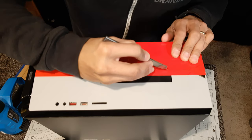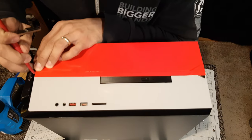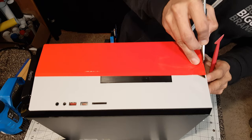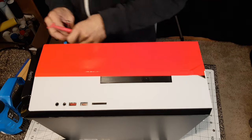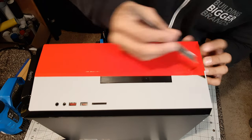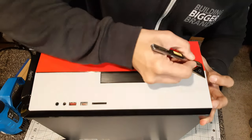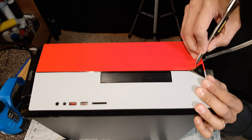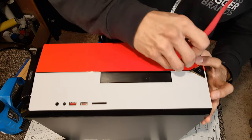I use my micro squeegee one more time to make sure I define and trace out that line really well. The better you trace out your lines, the easier it will be to cut and the more accurate your cut will be. If you don't trace your lines well, your blade can't follow a guided straight line and you'll be using more freehand motion. I've got that cut, peeled off the excess, and I'm going over the edges around the power button bezel to clean everything up.